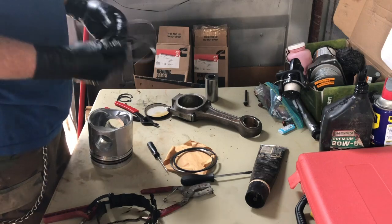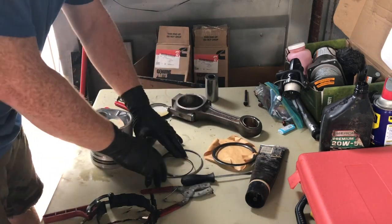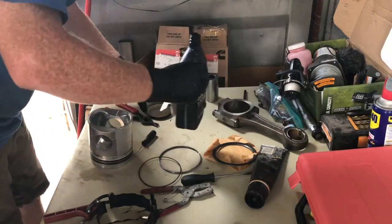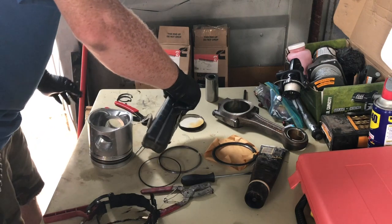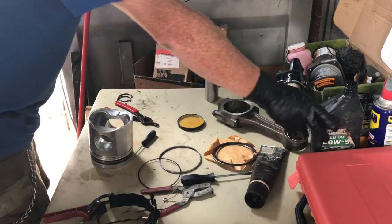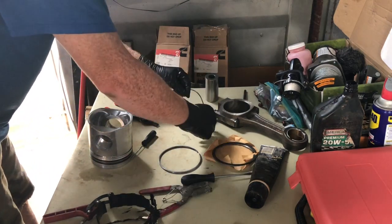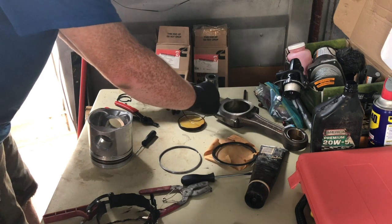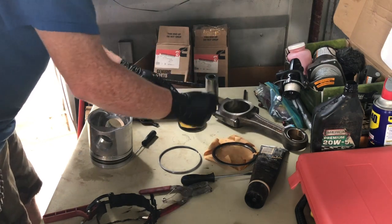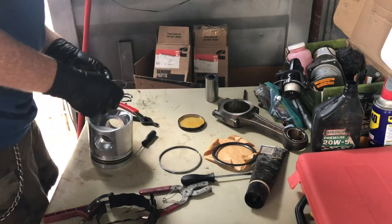The little control ring I just pull apart like that. For all this assembly I'll use just regular oil — this is 20-50 oil, but you can use 15-40 as well, especially since this motor actually uses 15-40.